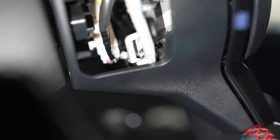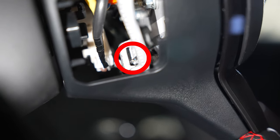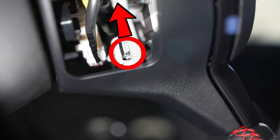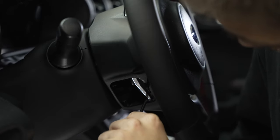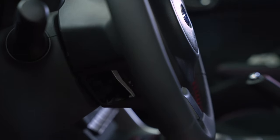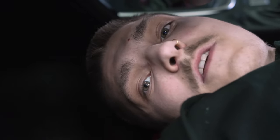Here we see one of the three clips — I'll make sure to highlight it in the video. Basically we're just going to want to push that thing up and you'll hear part of the steering wheel pop out. To get to the two top clips easier, you're going to want to lay down so you can actually see what you're doing in there, and as soon as you find them just give them a push.